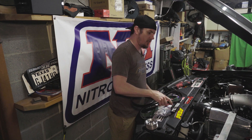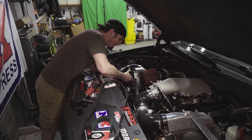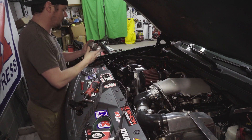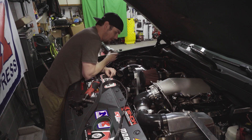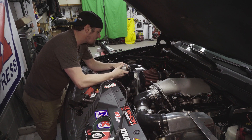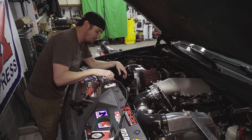Let's take a look at what's going on underneath here. We got it off, and there is some black dust on here from the previous belt — you can still see remnants of the last belt down in the grooves. I need to grab my strap wrench and then we'll swap over. Hopefully we can easily figure out the offset, but we may go ahead and grab the pulley aligner. These 928s — I think they're machined for standard offset, so if you need more offset for your setup you have to buy a spacer kit. On the Silverado they're all standard offsets on both the stage one and stage two bracket, so just keep that in mind.